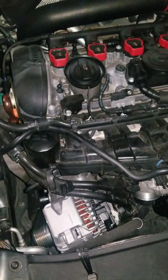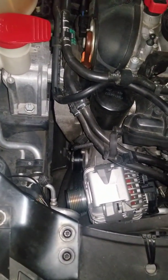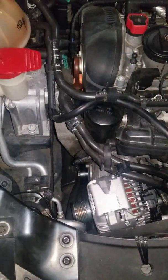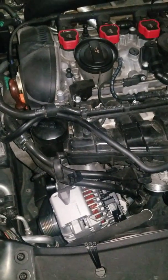Some cars don't have a clutch pulley. If you're having those kinds of symptoms and you don't have a clutch pulley, chances are it's not the actual alternator — it'd be like maybe a short in one of the wires coming and going. But if it has a clutch pulley, that's usually going to mean your clutch is fried. Now we'll go over how this is done.